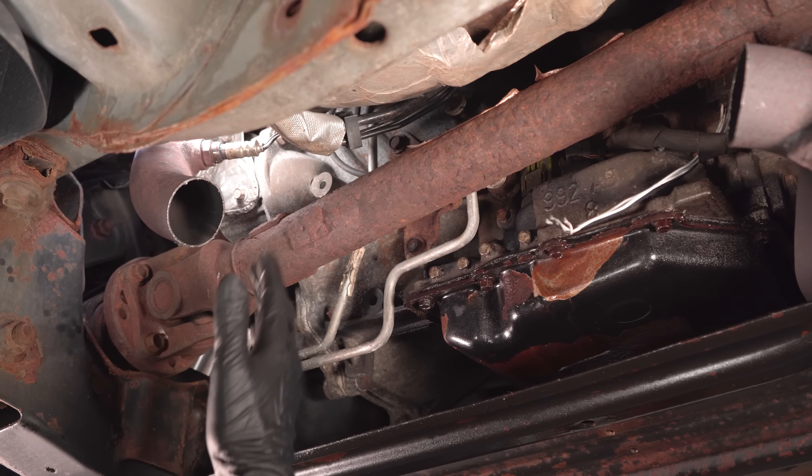It's been on here for a while and done its job for a long time. If I put a new one on this side, not only is it going to perform differently, it might provide different back pressure to the engine than the old one. Having both banks at different back pressures is not great — the engine wants to run evenly on the left and right bank. So I'd rather have two identical catalytic converters as opposed to one new and one old — it's kind of like buying tires. You don't just buy the left or right side; you buy both at the same time. I got this exhaust pipe kit from 1aauto.com — it comes split in half, the entire assembly, and it's going to be a lot easier to install. I also got the O2 sensor that is missing so I can replace that.